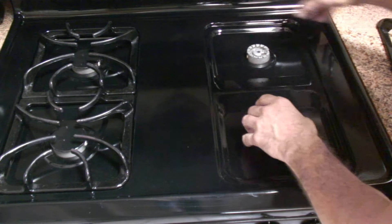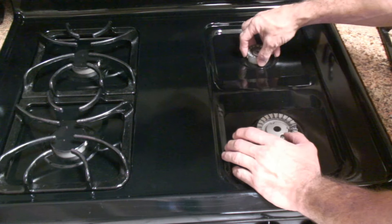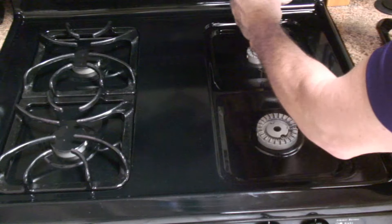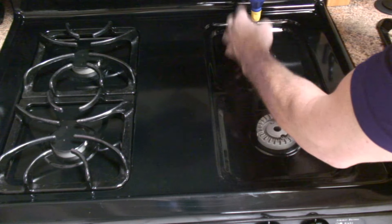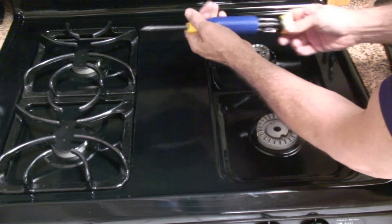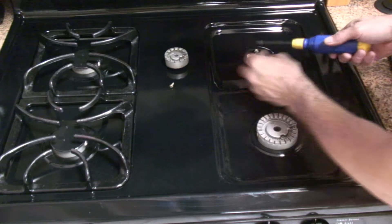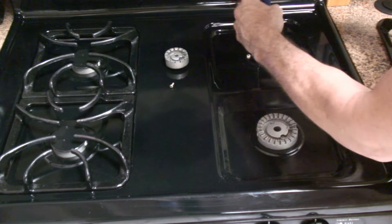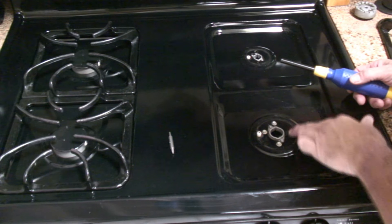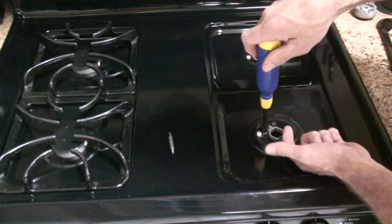Before I clean all the grills and burners, I'm going to take this apart and take the top off so we can get all these little crevices right here. You will also see how to get to the igniter and other parts in case anything else goes wrong on your stove. I'm going to take my Megapro screwdriver and unscrew this. The great thing about Megapro is they have multi screwdrivers with all the popular bits — I have 14 in the back and a socket in the front. I'll use my nut driver on it. This one has three nuts where the other ones have two. Make sure you take everything off before you remove the top, because you're going to pull that gas line with you.